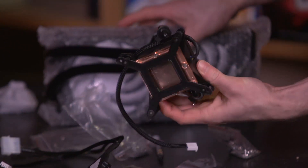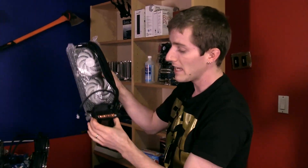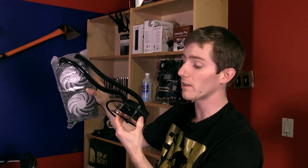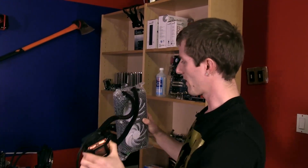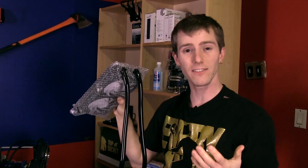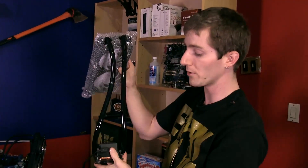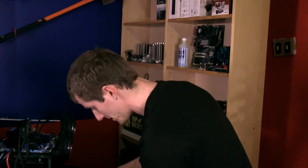One of the first things I notice about the block itself is how freely these joints rotate — it's very nice to see because normally they're stiff. These joints have to stay sealed no matter what pressure you put on them, and they swivel on the radiator as well, going all the way around. Having them so flexible means they won't put additional strain on the fitting that could cause it to leak over time.